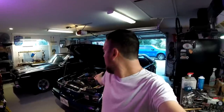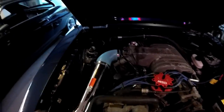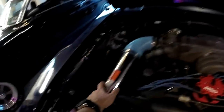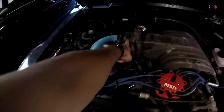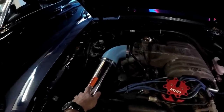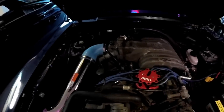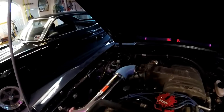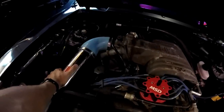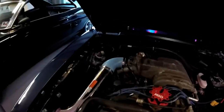Today we're getting rid of the smog pump. I'll show you how to do it with just the belt and not the relocation kit. You'll notice there's a new cold air intake on there, but it really didn't do anything because the bottleneck is at the heads, not the intake. It'll benefit once we get the intake and heads on, but for now it sounds cool and looks cool - I'll be honest, it does nothing. If anything, it's getting heat soaked and making the intake hotter.